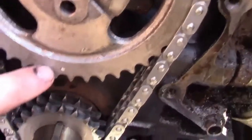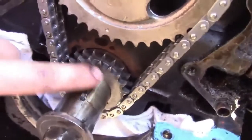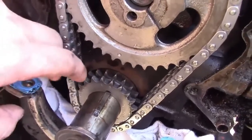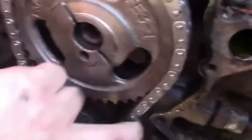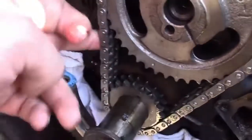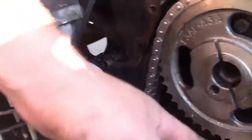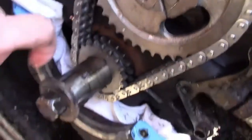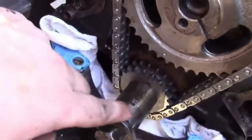So we have a dot here and a dot there. This is the double roller chain — this is what was on here before, so I wanted to show you this is how much play you have in a new one. As you can see it's significantly better than what we already had — it was pretty sloppy on each side. You can see they're perfectly lined up here. A good way to tell is if this is pointing down and you can see your keyway, you're pretty close.